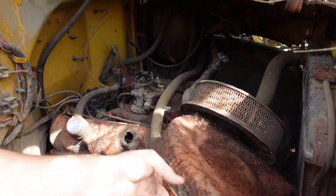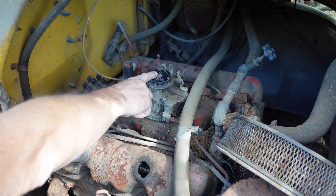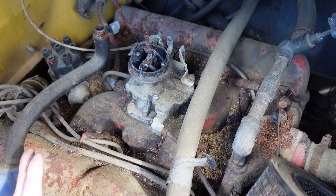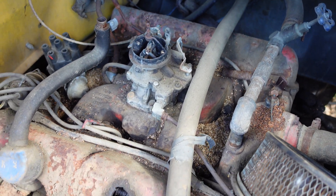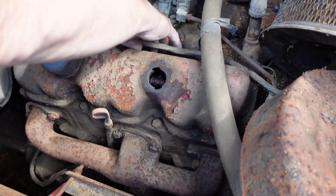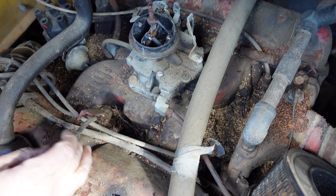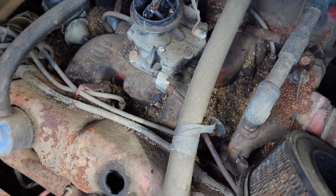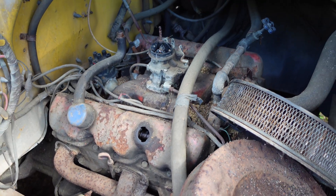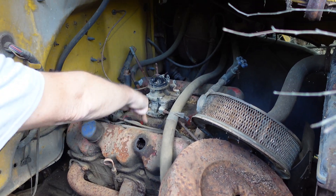This is the GMC V6. The thing with the V6 engine was that it was narrow — it was a 60-degree V, not a 90, so it was quite narrow. This has a two-barrel carburetor, which was optional on this particular engine; a single barrel was also possible. But look at the spark plugs, or lack of them, right here by the exhaust manifolds. Where are the spark plugs? They're inboard — they're up in here. The GMC 60-degree V6: the plugs go up top. The whole point was a compact engine.